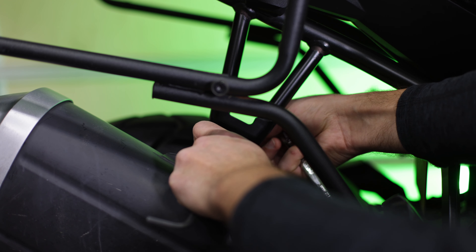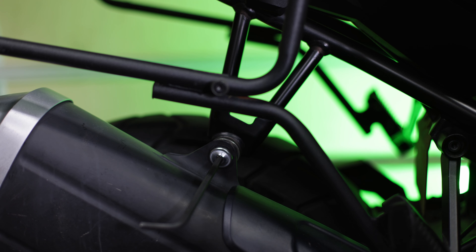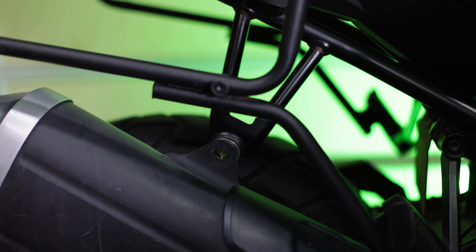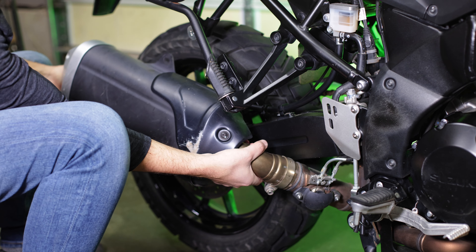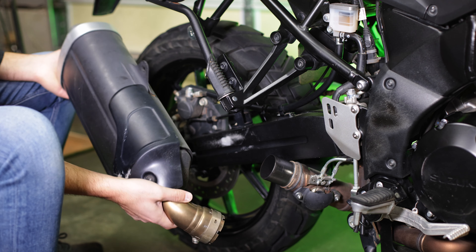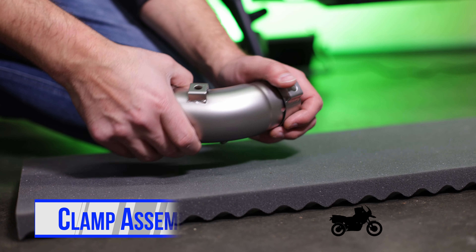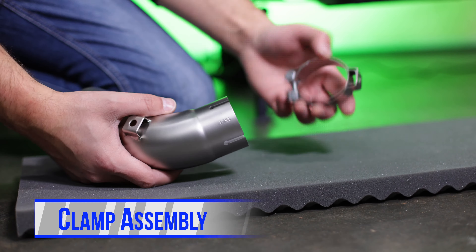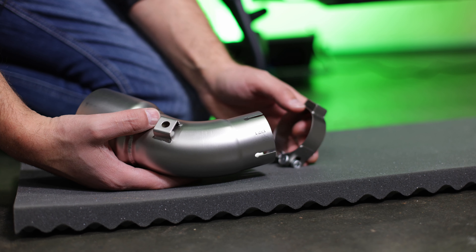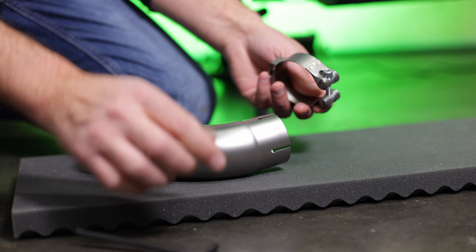Grab the nut in the back and make sure it doesn't fall off. You'll also notice there is a washer behind the nut — take that and set it aside. Leo Vince is providing all the hardware for this part, so I won't be reusing the stock hardware. Now that the muffler is loose, just wiggle it off. Before slipping the new one on to the factory exhaust, make sure you put the clamp on first. The clamp can go on in either direction, but there is a right and a wrong way.